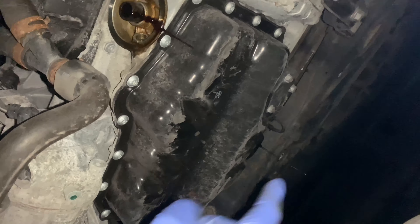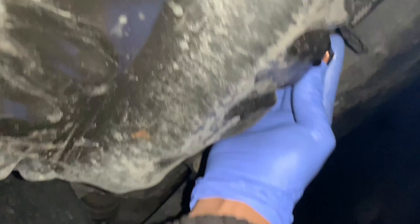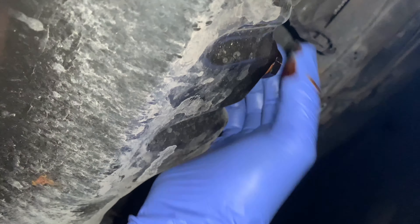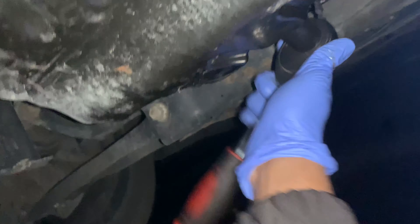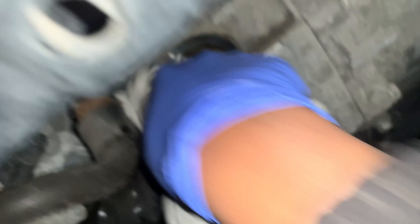I'm going to give this a nice quick little wipe down and give the drain plug area a wipe down too, then put the drain plug back on and put the new filter on. I'll clean this up, put the washer on there, put it back in, hand tighten it, give it a quick wipe down of the excess oil, and then tighten it off with the 19mm socket. You don't want to over tighten it — just when it comes to a stop is enough. I'm happy with that. Give this a bit of a wipe down as well.